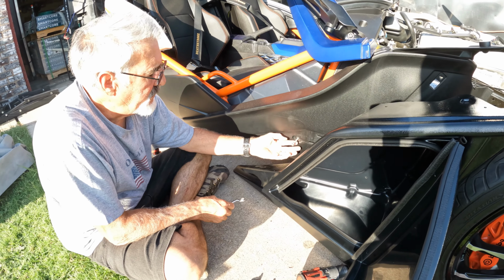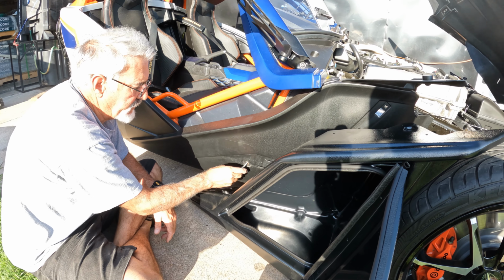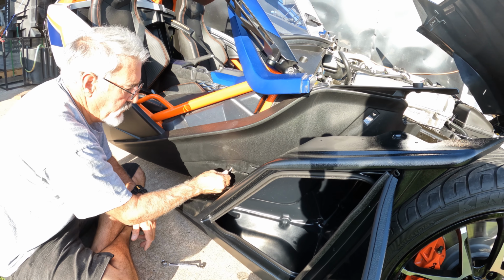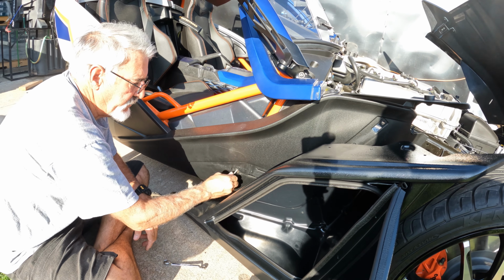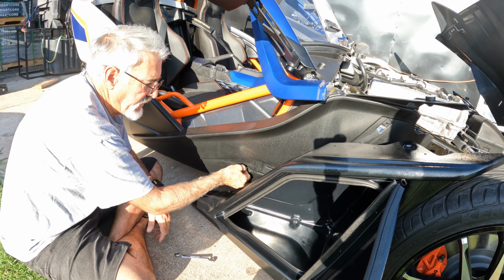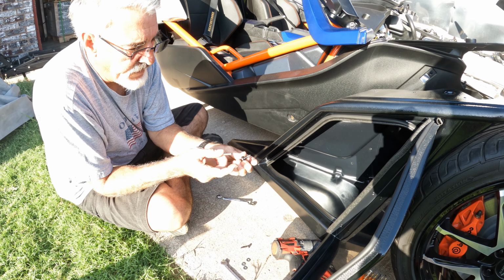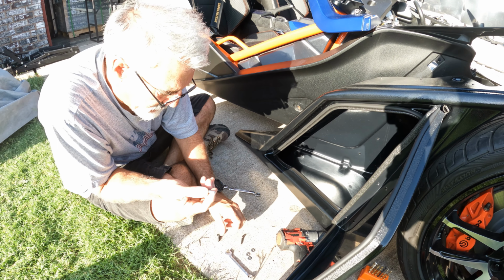Okay, this is a 10 bolt, and so what I did was I ran it in there to make sure that I could do that and get it going with my hands. And an old mechanic trick is you want to do like so. Not really hard, just enough to make sure it's good and you can turn it with your fingers, because that's what you're going to be doing when you start. You want to get that feel of it, because these are different threads. That's an auger type looking, it goes in at any angle, then it catches. Well, this isn't that way, so you don't want to screw your threads up to start off with.